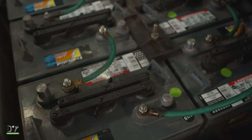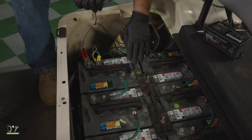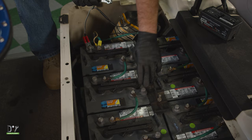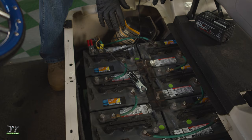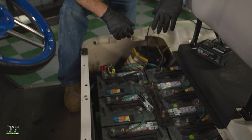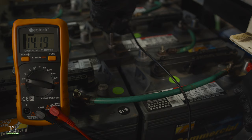This car has got six 6-volt batteries. I have a 12-volt charger, so what I'm going to do is hook my positive to battery one's positive. Since this negative would make this battery 6 volts, I jump to the corresponding negative, which would bring it to 12 volts. I'll go ahead and charge this pair for about one hour. Charging for one hour should bring the voltage up high enough to get close to 12 volts so the charger will recognize it.